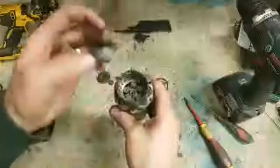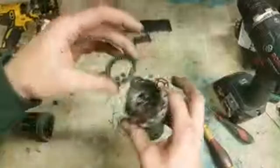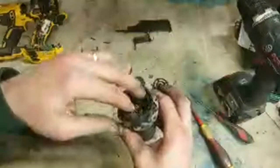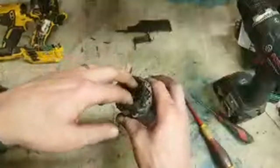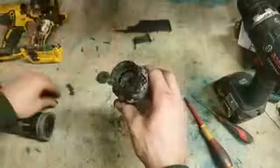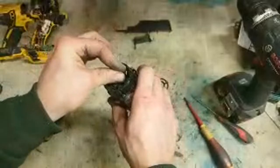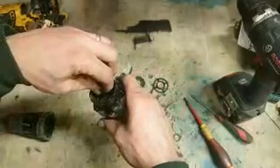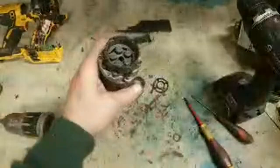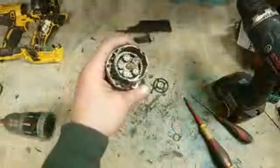So there are teeth down in here. That should be planetary gear that locks. There's one that your selector is actually hooked onto. It slides in here. There's one that's actually raising up and down. So that sits on there. These gears go on top. Put a wee bit of grease on now. And that's all I put on. Little dab.